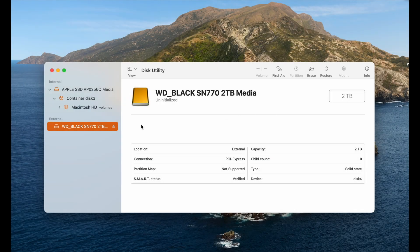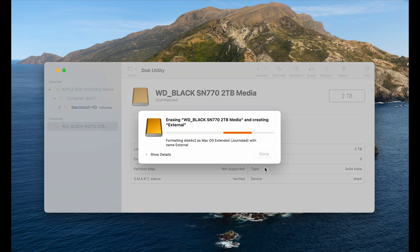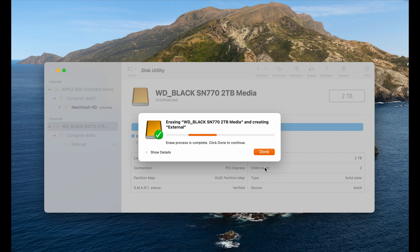Right now I have the hard drive hooked up directly to my MacBook Air. We're going to format it — open Disk Utility, click on Erase, change the name to whatever works best for you, and make sure the format is APFS. That's going to give you the maximum speed for your hard drive. After you do that, click on Erase, wait about a minute, and your hard drive will be formatted.